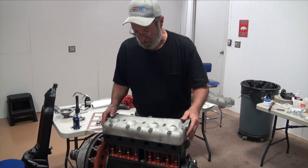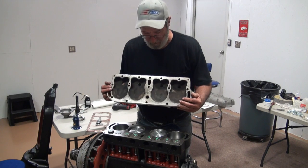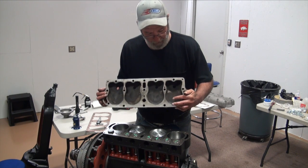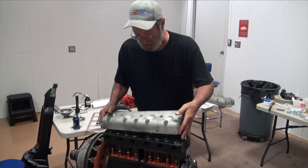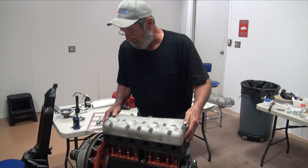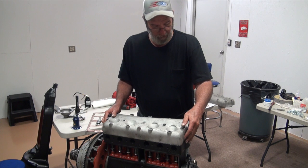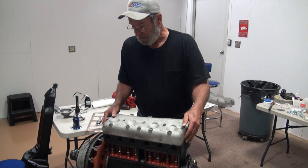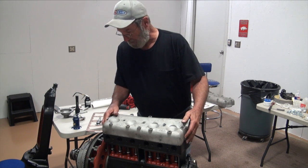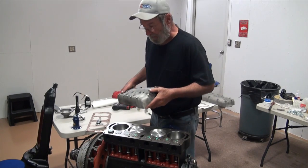You can, in a pinch, use some modeling clay — just take a ball and put it on top of the piston where it would contact. You'll notice this is a head that has been used. Put it up in a couple of places, run it through with the bolts on it, peel it off and see what your clearance is. A 50 thousandths squish is a number I've been told you don't want to get any closer than. So this will be the head that we'll use, and when I put the gasket on it I'm just going to gain another 50 thousandths. We'll use this for our project.